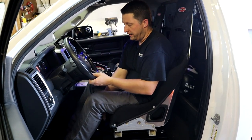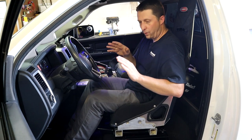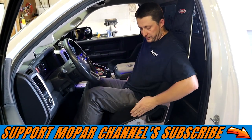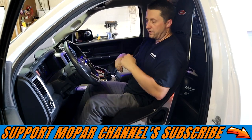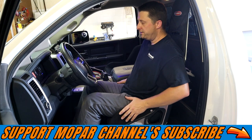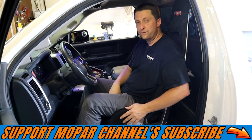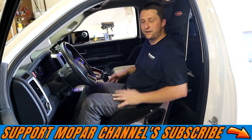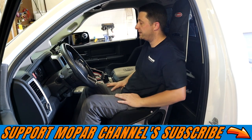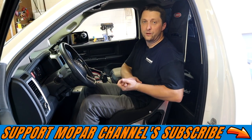On the brackets, you can remove a bolt and adjust your seat angle back or forwards by just moving the bolts around a little bit — pretty straightforward. I love it. These Kirkey seats come up pretty high and they are very comfortable — you kind of feel like you're just being hugged, really snug, cradles you really well. A lot of people would think you're just sitting on a metal pan, and technically you are, but the covers and the way they're designed make them very comfortable. I actually think these are more comfortable than my factory RT seats. That'll do it for today — stay safe, hit that subscribe button, and we'll see you on the next one.